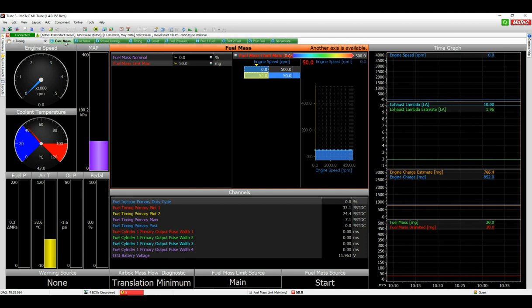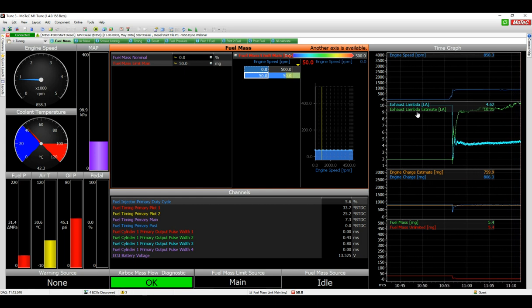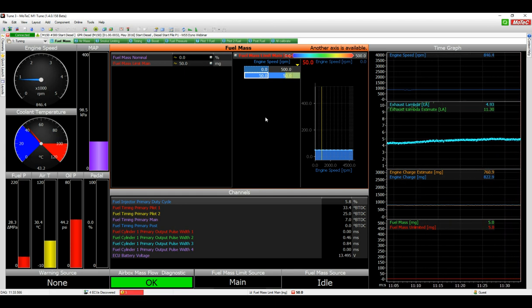Let's get into it. I'll press F5 to get over to the fuel tables, and I can see my lambda is online — it's reading lambda 10 because the engine isn't running yet. We'll just turn the key and start it. We're away — we've got oil pressure and fuel pressure at 28 MPa. The injector calibrations aren't very good at idle, but that really doesn't affect you because you're not using the lambda estimate channel much at low engine loads. It's very difficult to get injector calibrations perfect at idle.